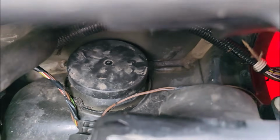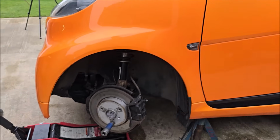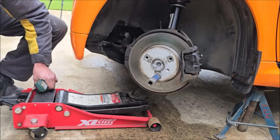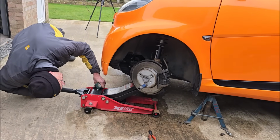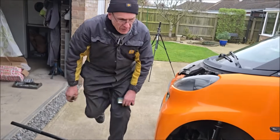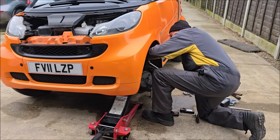So I've got the cap back on there because everything's been tightened up suspension wise. We're just putting on the disc and the pad carrier and the caliper. Taking off the weight. Getting everything nice and tight. Check all the bolts, to be honest with you, and that's it. Checking the bolts, putting the wheel on, and then we can give it a measure. And then, important, cup of tea. We're going to check the bolts.